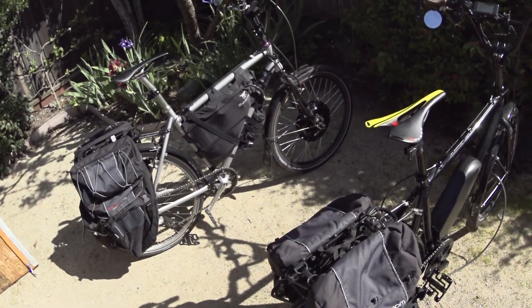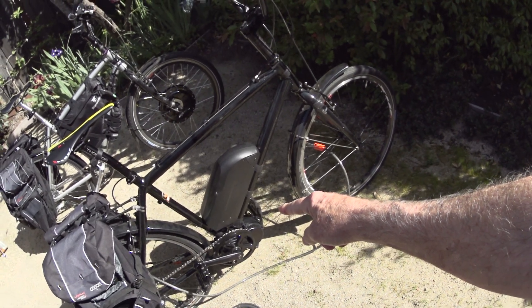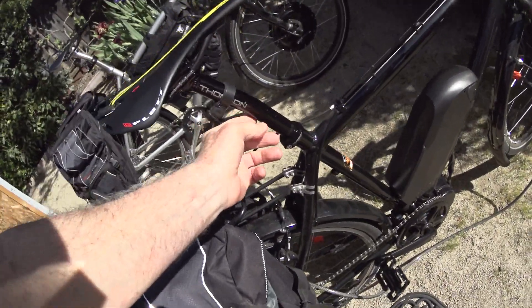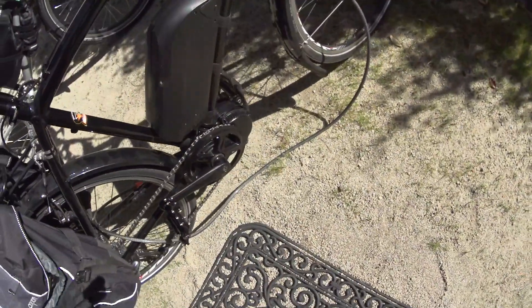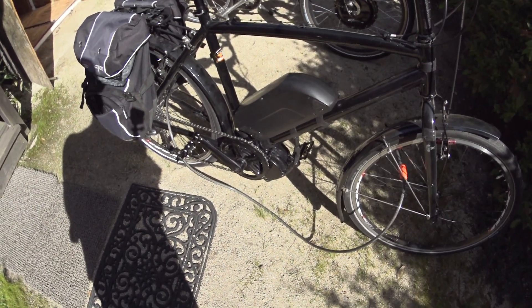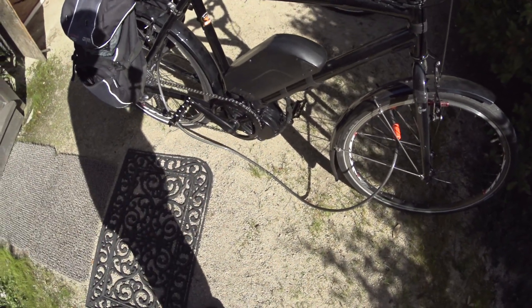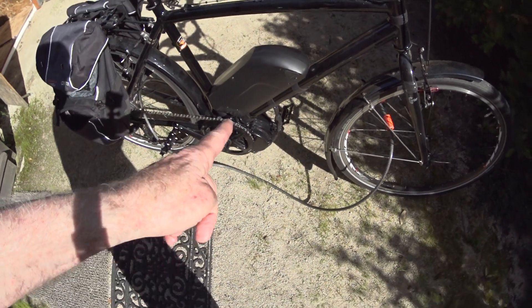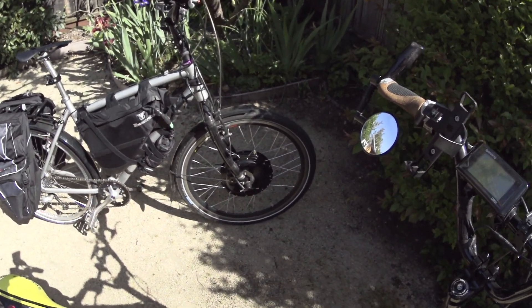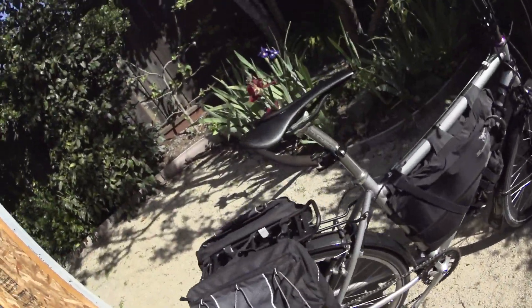If I could only have one bike, I would probably do the mid-drive motor and go with the Bafang BBSHD, which is a heavier-duty motor — that way you can still add trailer capability. I don't think I'd feel comfortable pulling my big trailer with just this smaller BBS02 — it's a great commuter motor, very fast and zippy. I tried one of the BBSHD motors once and to me it was sluggish, slower, and heavier — about three pounds heavier — and I really preferred the performance of the BBS02.